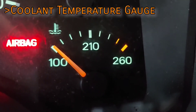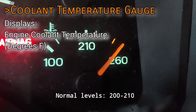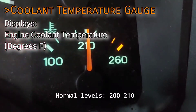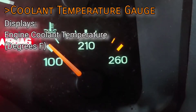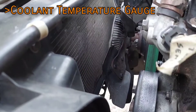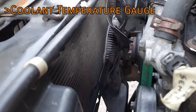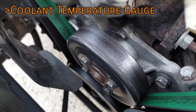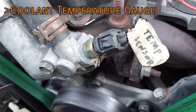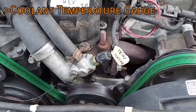The lower right gauge reads engine temperature in degrees Fahrenheit. Normal operating temperature for the 4.0 is between 200 and 210 degrees, and if equipped, the electric radiator fan should activate at 218 degrees and deactivate once the engine falls back below 210. If your engine is overheating, don't continue driving — shut it off and let it cool down. The sensor for the temperature gauge is located at the front of the engine on the thermostat housing. If your electric fan doesn't come on, try replacing this sensor, as this is what activates it, and that fixed the problem for me.